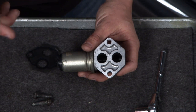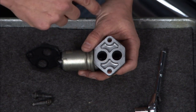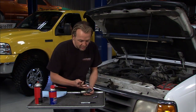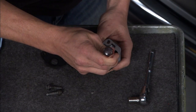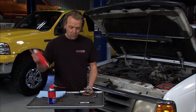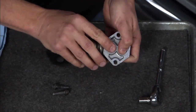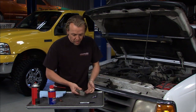There are a couple of different schools of thought when it comes to cleaning this. Some guys will say don't touch the spring in there. You can see the little spring in the plunger and that moves back and forth. The part's not working, so how much harm are you going to do, right? There's carbon buildup — sometimes it'll hold things up and hold it in one spot and that's why it's not working. So you want to get that cleaned out. You can kind of move things loose a little bit, loosen it up. You don't want to break anything, so don't be too hard on it. Then you get in here with a little throttle body cleaner and spray it right into these two holes. That's where the issue is — sometimes you've got some carbon buildup in there. So you get in there and clean that out and kind of shake it around.